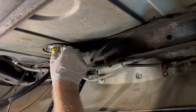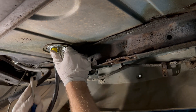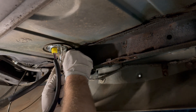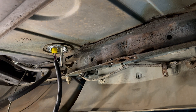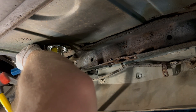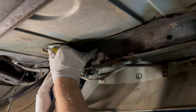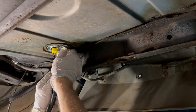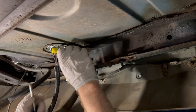At this point I am ready to secure the retaining ring in place. Unfortunately I did not film this to the end — this was very difficult and took me quite a long time as I did not have the correct tool at my disposal. I highly recommend saving yourself the pain and suffering and get the fuel tank lock ring tool, which seems widely available online for about $20. At this point everything is complete with upgrading the fuel tank, with the exception of the wiring. In the next video we will start the install of the sniper unit on the engine and run the wiring from the fuel sender up to the front. See you on the other side.